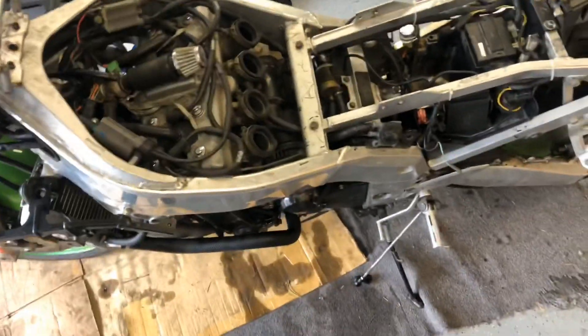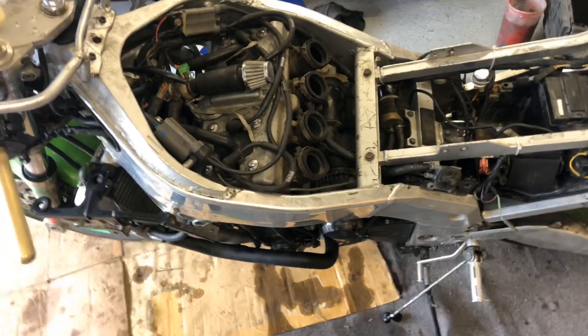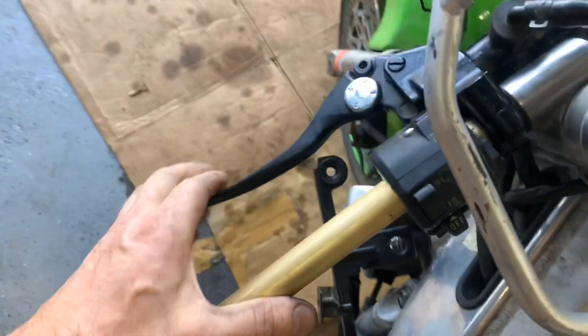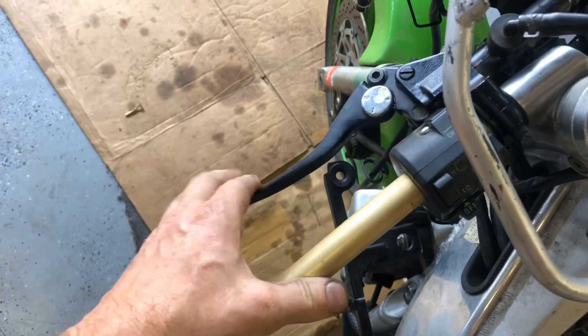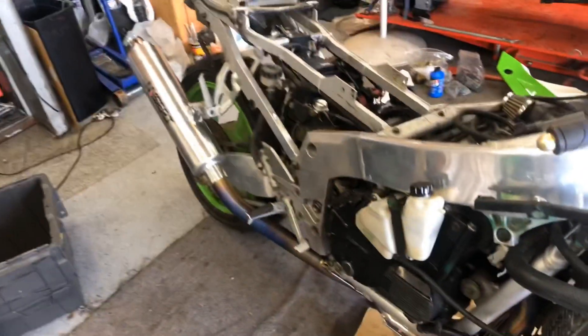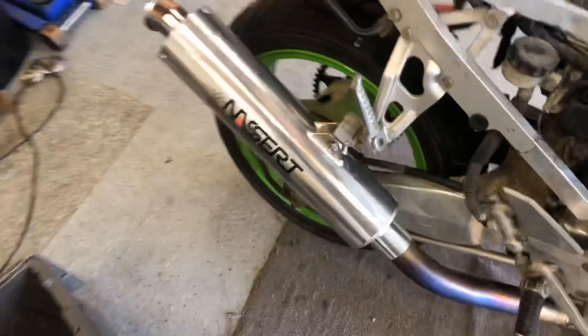It's hard to say how much time I've been spending here sorting this whole thing out, but it's been a struggle. I did get this clutch line routed and bled the clutch out, which kind of feels odd because it has pressure but it's kind of stopping travel here. So I don't know - maybe this is the wrong clutch lever on here or something is incorrect. Got the entire exhaust system installed and that was a gigantic pain in the butt - had to kind of fight it on the end to get this thing lined up.